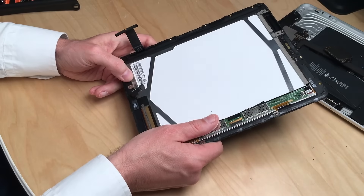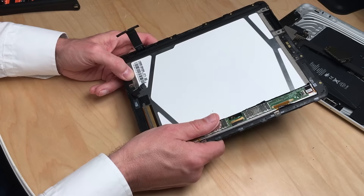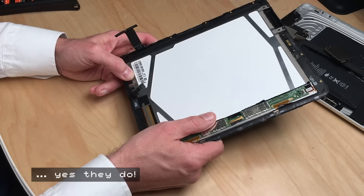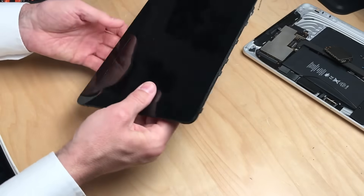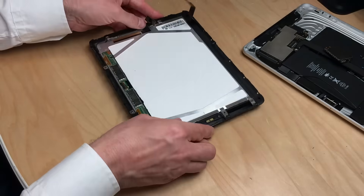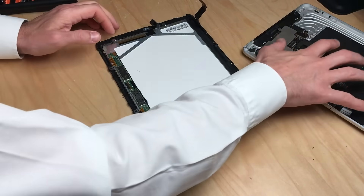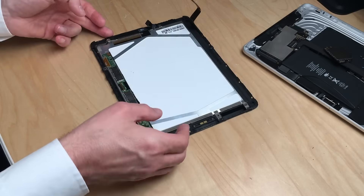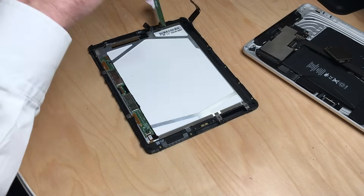I was a bit nervous about that because I didn't know if I'd be able to get a driver board to drive this display. All iPad 1s have an LP097X02-SLD6 display. That's the product number, and if you know the display number you can go on eBay or Amazon and order a board that replaces all the driving mechanisms inside the iPad itself — and that is just what I got here.